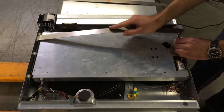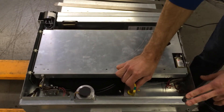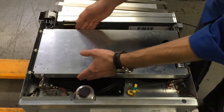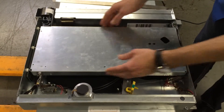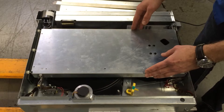There's two of them. Next step, we need to pull on this yellow tab just to make sure it's released completely all the way up. And next step, I also double-checked that the picker has a little bit of play. It shouldn't have too much, but just a little bit. If your picker does not have any play, then you could have issues with it not being able to properly move.